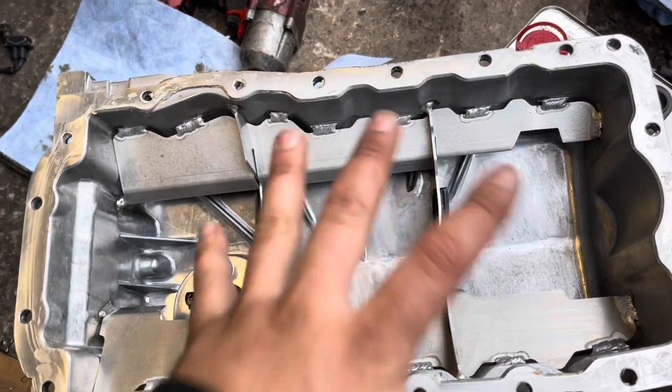But when it's trying to go this way, it's going to hit that flap and it's not going to flow as well. So yeah, that's the idea behind a baffled sump — it's going to stop you getting oil pressure issues on long corners. For road driving you really don't usually need to worry about it; this is more for track use with long sweeping corners. Anyway, hope it's been helpful — see you on the next one, cheers guys!